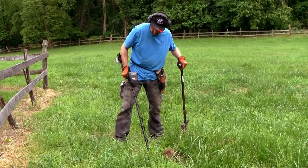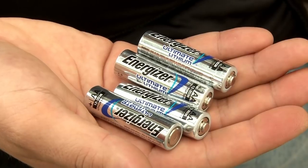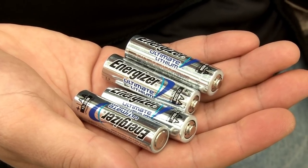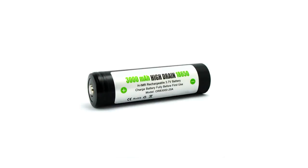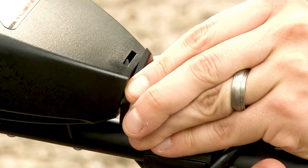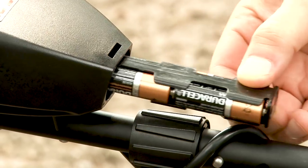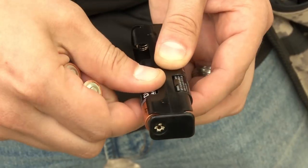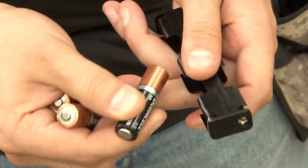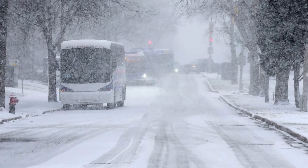Expect up to 20 hours of operation depending upon the type of batteries used and their quality. 1.5 volt lithium batteries can also be used, but 3.7 volt lithium batteries will damage the detector and should not be used. Access and replace the batteries by rotating the battery cover housing one-quarter turn counter-clockwise, then pull and remove the cap to slide the battery holder out. Remove the batteries when the detector will be stored more than 30 days, and avoid extreme temperatures such as storing the detector in a car trunk during summer or in sub-freezing weather.